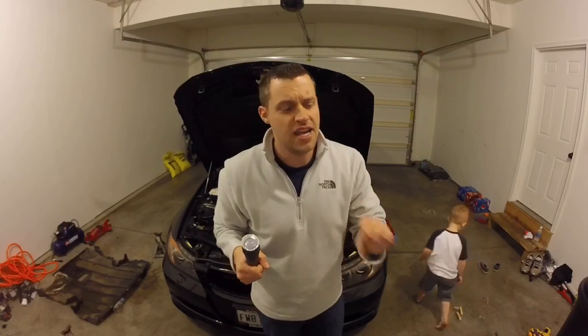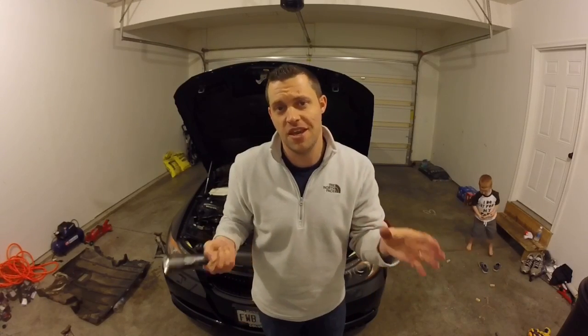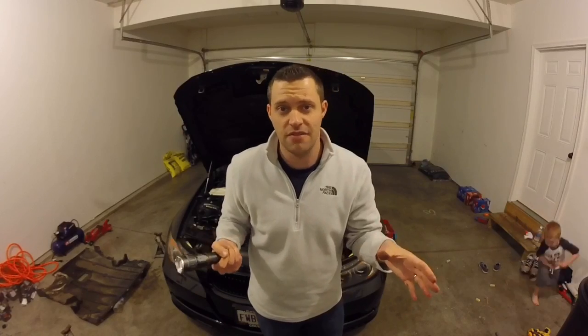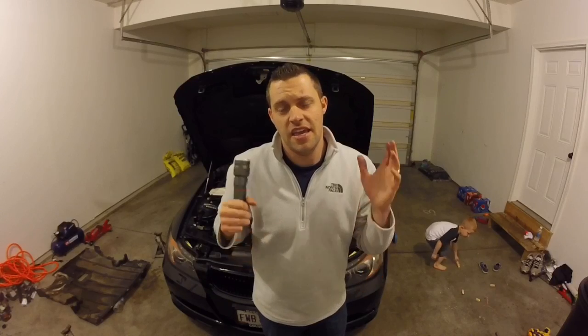All right, everyone, as easy as that. Please be sure to upgrade your charge pipe before adding a tune to your N54, just so you have peace of mind. I did okay when I ran the stock charge pipe, but it can get really risky when you start adding more than stock boost. You don't want to be broken down because of your charge pipe, then have to wait a couple days, maybe a week, depending on which one you go with and setup. So go ahead and replace it early. It's much better to have a 100% metal piece versus flimsy plastic that can break. It definitely changes a day, and your N54 will like you for it.